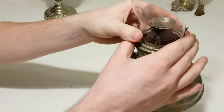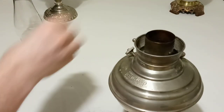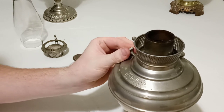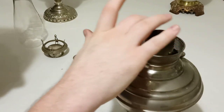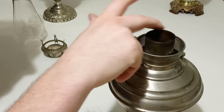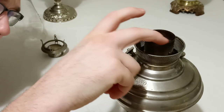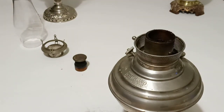I'm going to go ahead and turn it off again. Flame spreader back out — could be hot, so just be careful. I have it just barely visible above the top of the wick tube. I'm going to go ahead and rub it with my finger. Always choose one direction — don't go in two directions. My standard is clockwise, so if I ever have to do a lamp a second time in the future I know not to mess it up. Looking at it level, this looks pretty darn even. Now this method works on pretty much all center draft and even some side draft lamps, as long as they have a round wick.